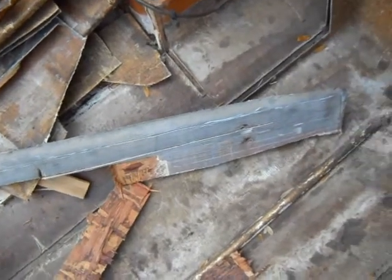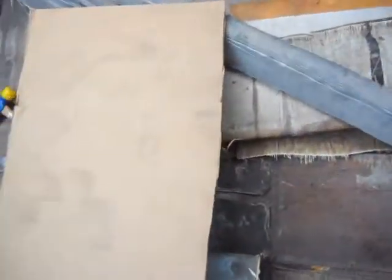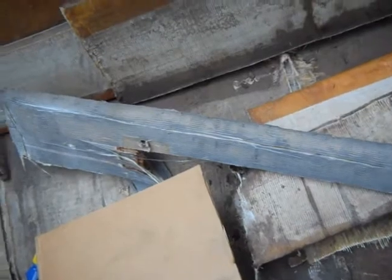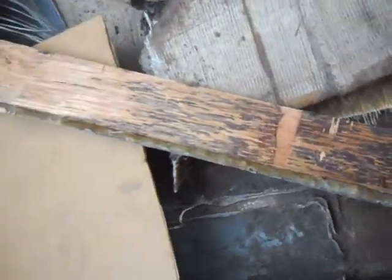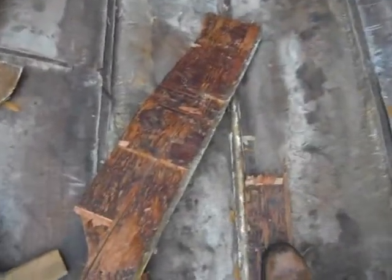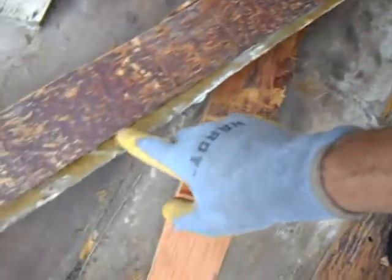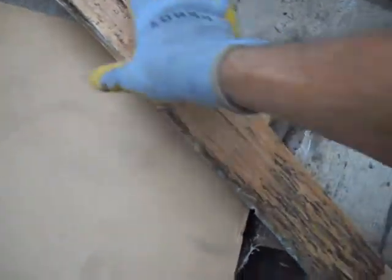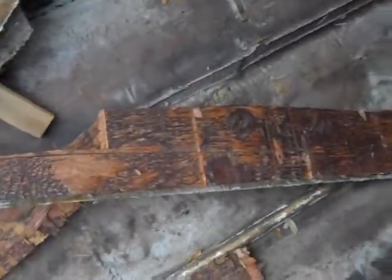So the very top cap of the transom on the inside came out essentially in one piece once I got up there and started getting on it with the pry bars and the chisel. I guess it was glassed in to the top part, but not very much contact. I don't know if I'm looking at this correctly or not, but it just doesn't look like there was any mechanical contact on this glass where it wrapped over, and obviously just riddled with potential openings for water to get in.